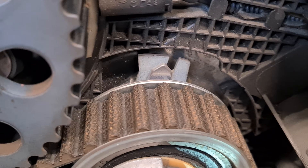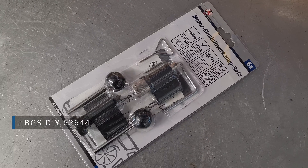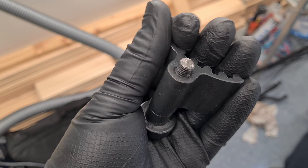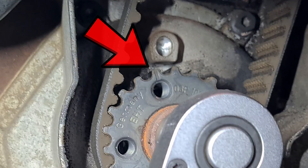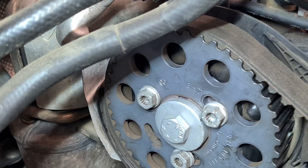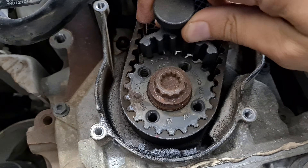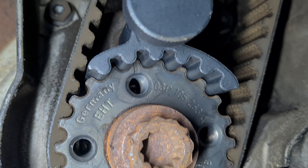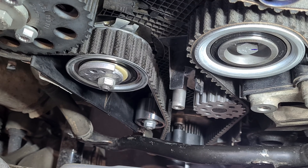The arrow shows the tension is slightly out. We bought a crankshaft fixing toolset — it fits well, but the metal quality is doubtful and we managed to break the pin of the tool. Turn the crank clockwise until the mark points upwards. The arrow on the camshaft pulley must also point upwards; if not, turn the crankshaft another 360 degrees. Mount the crankshaft fix tool from the side — two markings on the pulley and fixing tool must match. Turn the crank back and forth to insert the pin into the engine block.